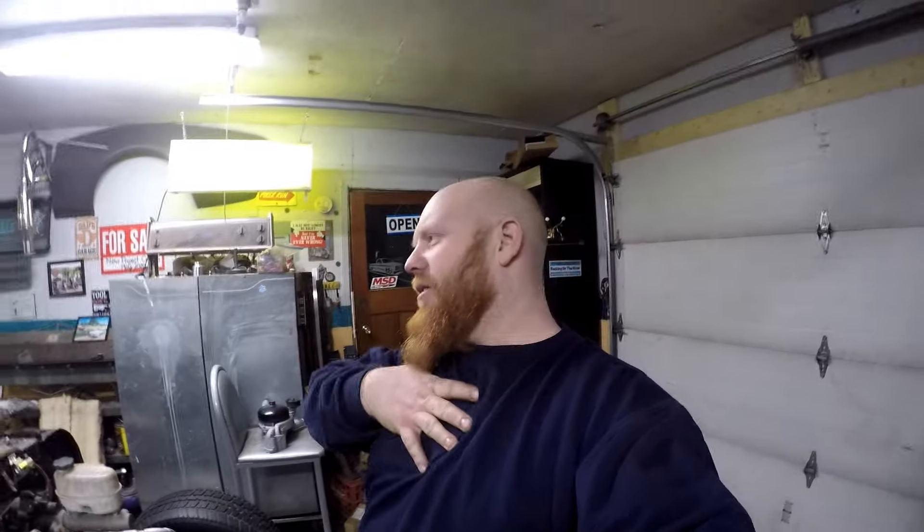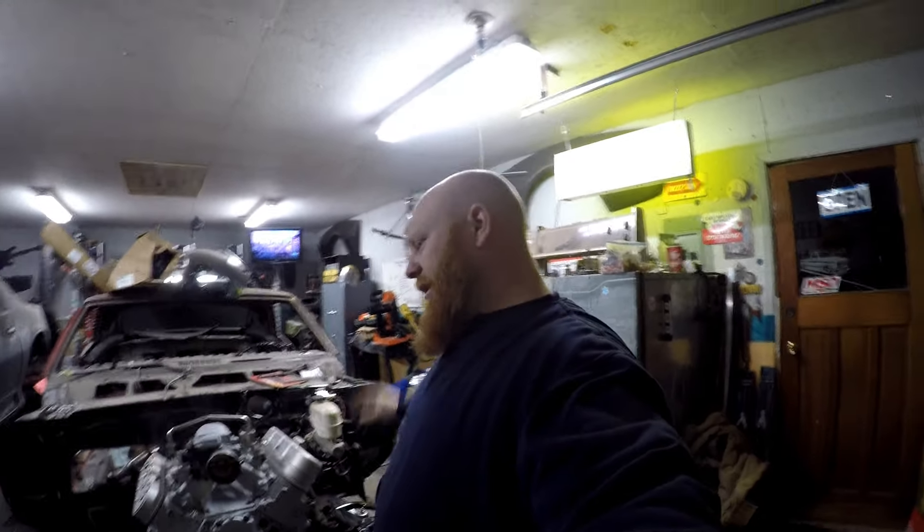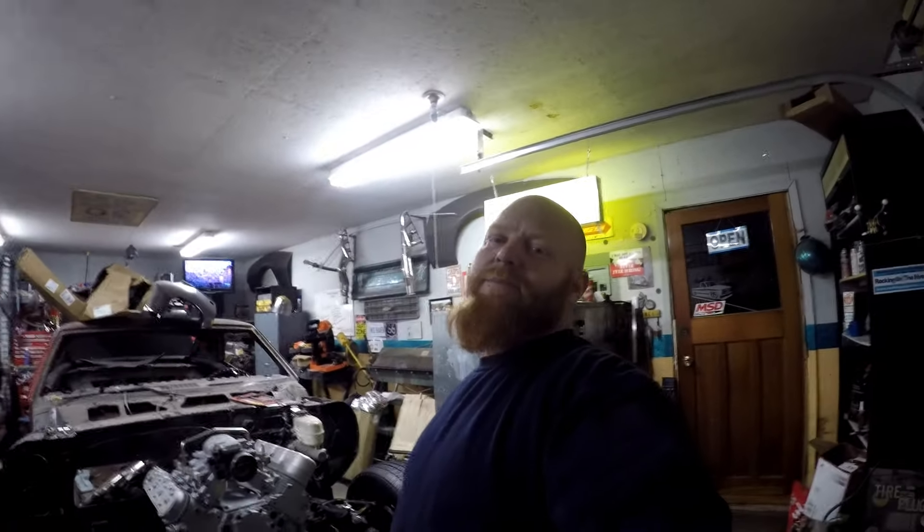He's on his way — seems like a reasonable guy. Maybe we'll get a job to swap a motor, but I don't want it right now since I'm going on vacation. After doing some research, it turns out it's probably not my fault and not the guy's fault either. He has an '04 truck — he reached out asking if I had an engine, I said yes, it ran good. I didn't ask what year his truck was, and apparently 2002 and 2004 don't jive because of the tone rings on the crank.